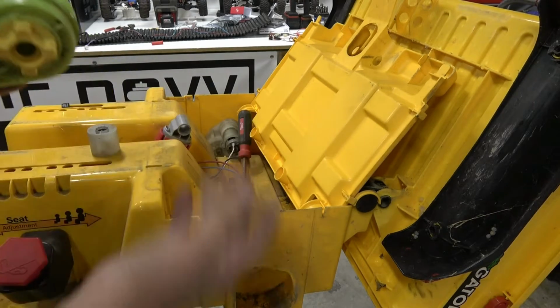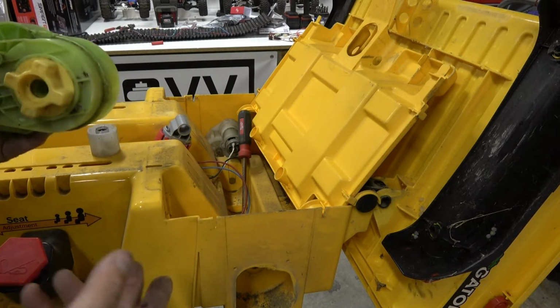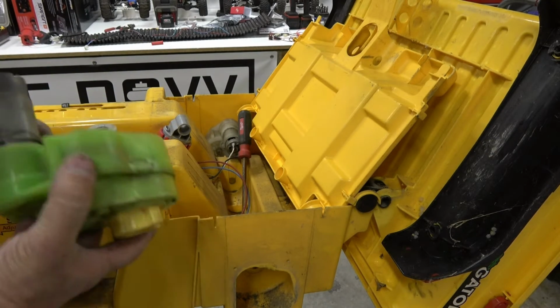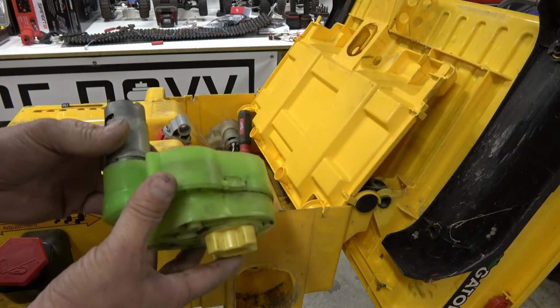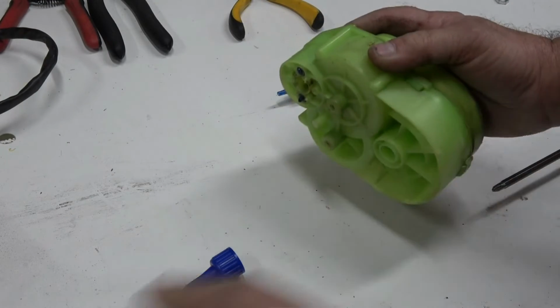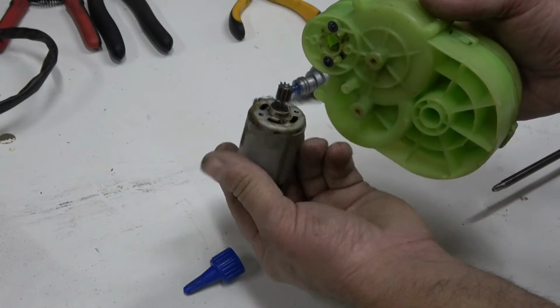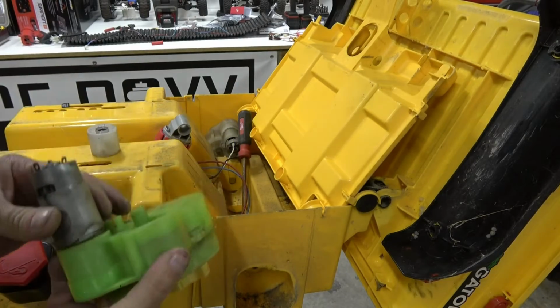I don't know if they switched it trying to get things going, kind of like an unqualified mechanic, just start switching parts because it wasn't working at the shifter. So what I do recommend is when you have the screws in there, put a little dab of blue Loctite on each one before you tighten the screws. And don't over tighten them, just get them snug.